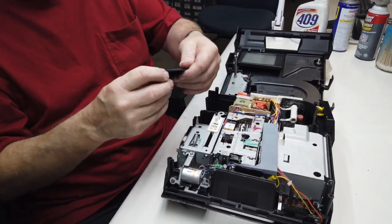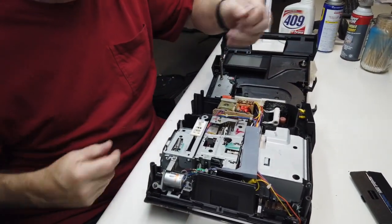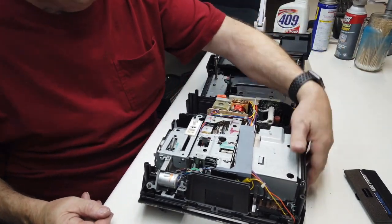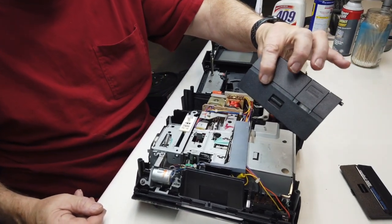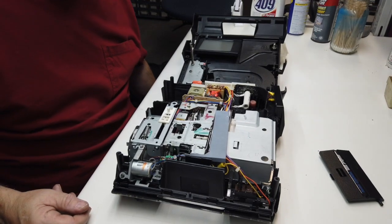Pull out our cord storage door, and usually just throw away the spring — Kodak made a change and got rid of the springs. Go ahead and pull our door off the back side for the lamp module. It's garbage; the new lamp module has the door built in.